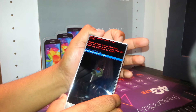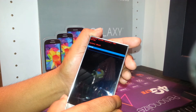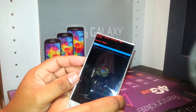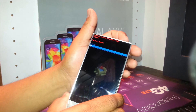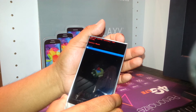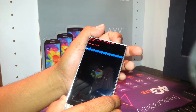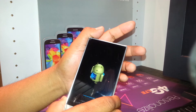You'll see 'Factory Reset' and 'Cancel.' We want to perform the factory reset, so scroll down using volume down and select it. Press the power key — holding it once won't do anything, so hold it for about three seconds. There you go — the reset is now performing.